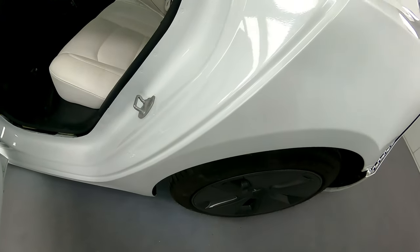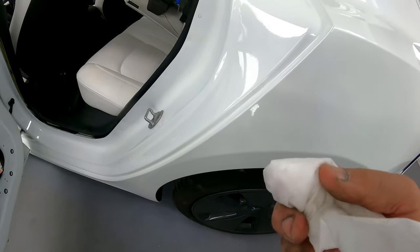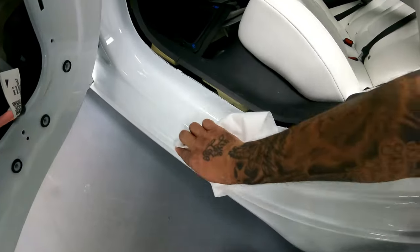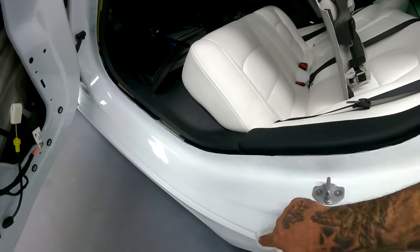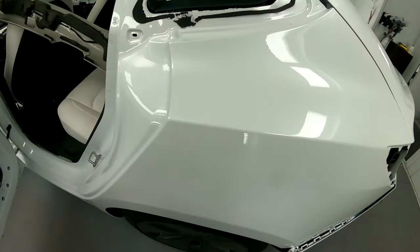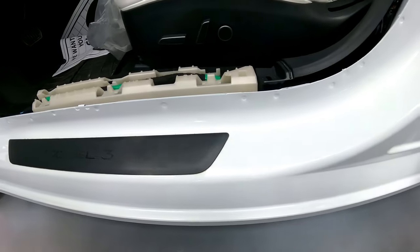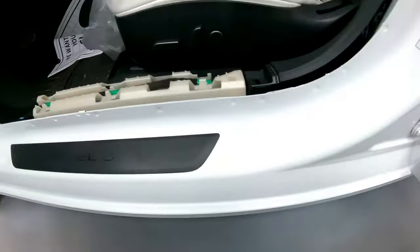The jam didn't come out too bad, and one little tip I like to do even when I do my fold tape: take a little prep solvent on the end of your towel once this is dry and just wipe the jam. It'll take any glue residue, and even if there's a little clear it'll knock it down with that prep solvent. So far so good with the foam. You guys can check out the prices on it — they said it's cheaper than the other stuff, so definitely not a bad product. You could also hit it with a little compound to knock down the edge and polish it up if you have to, but this one came out pretty good — it's got a nice shine along that lip and it held tight.